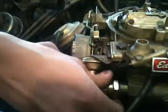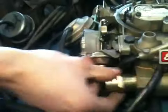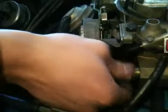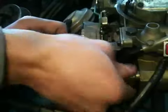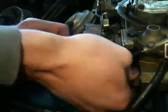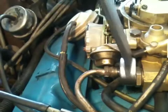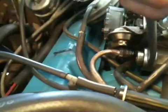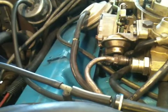Okay. Get that back in there. And we'll start it. And once we get it a little snug with our fingers, we can go ahead and just tighten it up with the 1-inch wrench. And on my 1-inch wrench, I went ahead and made a notch in it because it's easier to get over the fuel line. A lot of times you can use the open end of the 1-inch, but a lot of times it'll round off. So I went ahead and kind of modified that one myself.